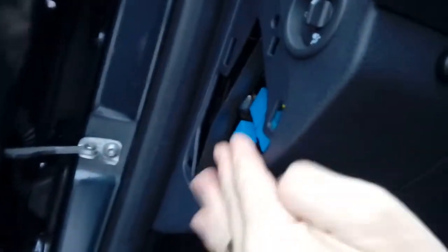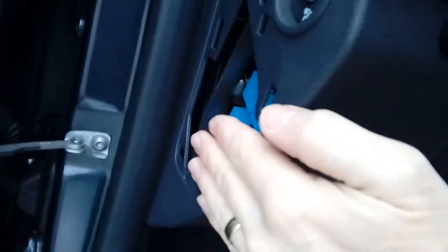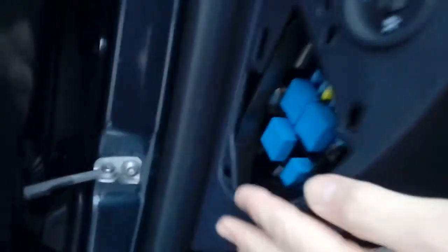Run the cable all the way along until you get to the corner. When you get to the corner, pop it under the trim again — your plastic levering tool will help with that. Then the side trim rubber seal: if you just pull it quite firmly and wiggle it, it will actually come away. You're going to run your power cable all the way down here to the location of your fuse box, which is under a little cubby panel just here. The cubby panel just pops off — get your plastic leverage tool under the bottom of it and it'll pop off; some can be stubborn. Your fuses are all in there.